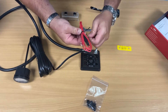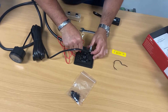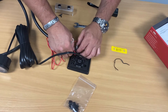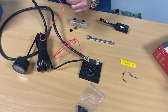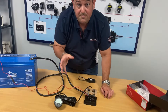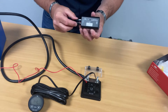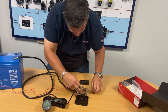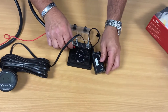This is the positive sense wire — what's quite nice is it actually comes with the fuse already in-line. The Expert Modular battery monitor will monitor the voltage of up to two other battery banks, so if you've got an auxiliary battery and an engine start battery, or perhaps an auxiliary battery, an engine battery, and a radio battery, you can monitor the voltage of each. That's the Expert Modular installed with rubber bungs in the unused ports. There's one extra item we're going to install today — this is the Bluetooth QuickLink connector, which simply plugs into the smart shunt and gives us Bluetooth functionality for the unit.